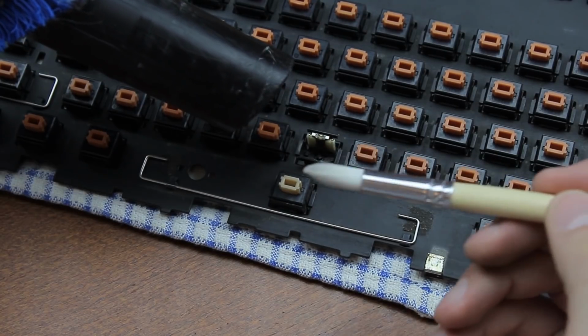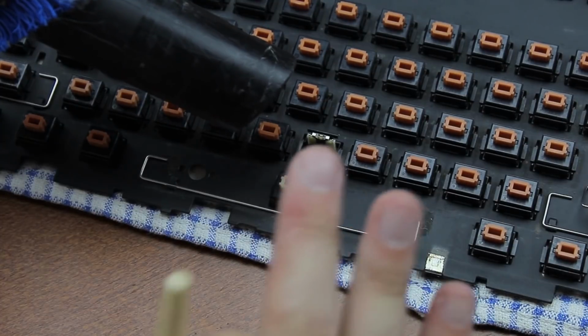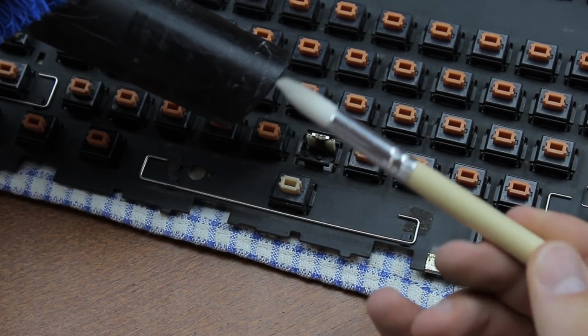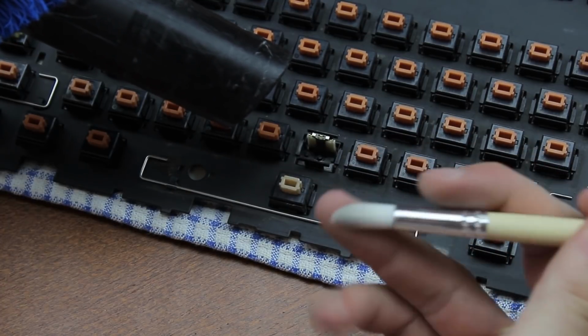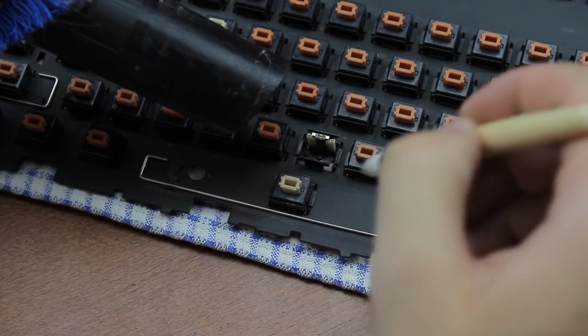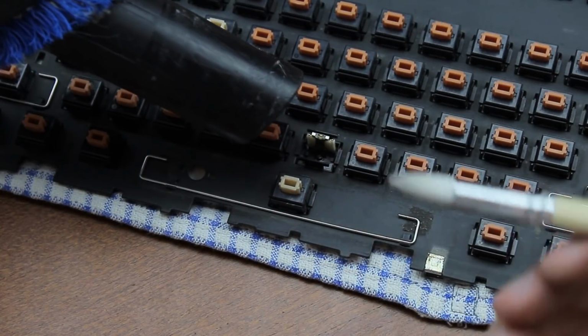In order to clean them out, we're just going to take out the dust. More shouldn't be necessary, and with Alps I wouldn't do more than is strictly needed, to be honest. So first, get a nice brush like this. It's easier to do if the brush is sharp rather than bushy, and hoover at the bottom housing while you brush towards it, like this, so to speak.